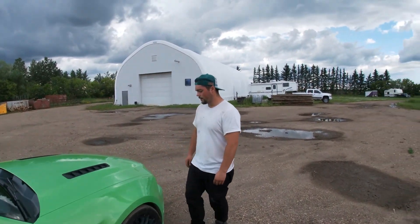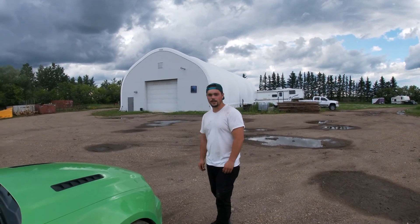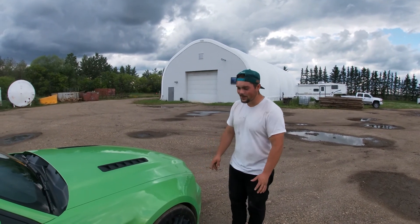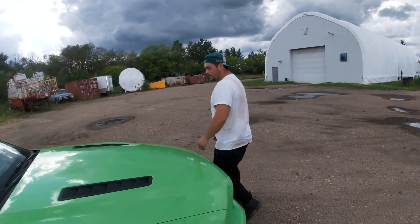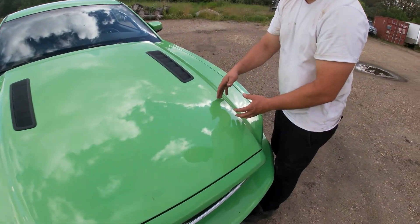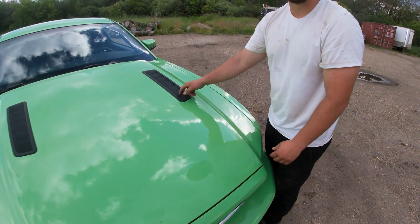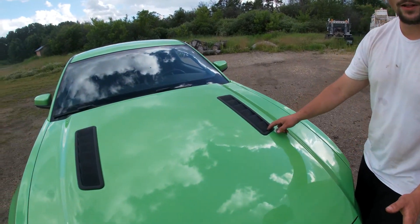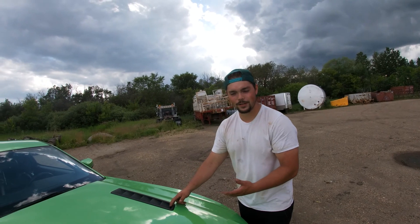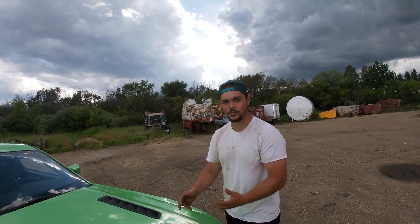I bought it used — 50,000 K on it when I bought it. It came with a cold air intake and Magnaflow exhaust. One big design flaw I found out about is the cold air intake runs basically from the intake all the way to here, and the hood vents are actual hood vents. This isn't a Challenger where the hood vents are fake — water gets in and starts causing the MAF to do a bunch of crazy stuff. She starts backfiring like crazy, so that's an issue.